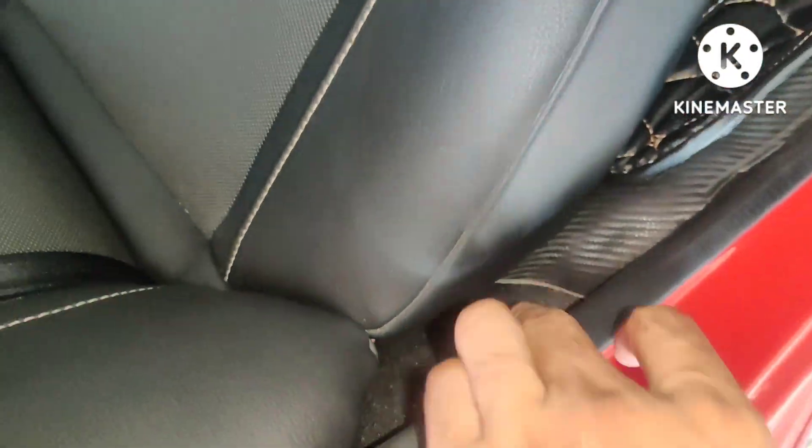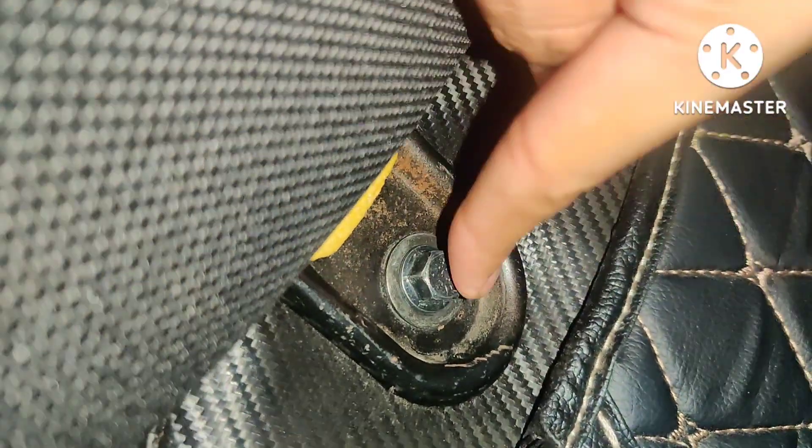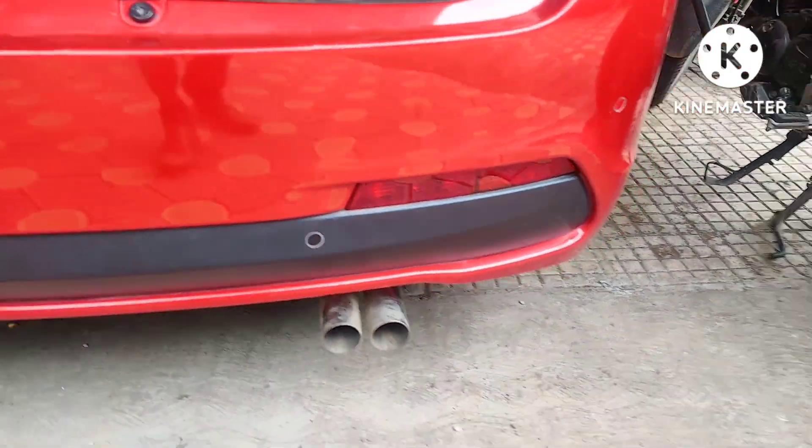So it acts as an ambient light in this box — I'll turn off the flash to show how it looks at night. I stuck the fuse box diagram here which was earlier on the panel. The wiring is totally concealed — you cannot see it anywhere. You may find it quite difficult to pass the wire, so I suggest removing this nut, pulling up just this part slightly, and then routing the wire from here. This is the boot cable used for opening the boot, and my wire is totally concealed under it. There is a rubber gasket inside — I've installed it completely and punched a hole through it.